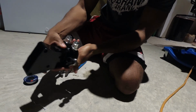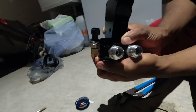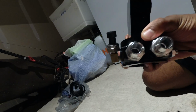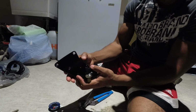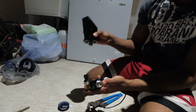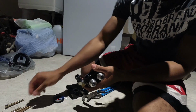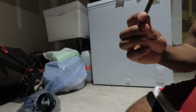Yeah. Just make sure to test fitment. Everything is going. I mean, obviously you're not going to be able to get it any closer because it's right up against the sandwich plate. You know you've got it right. You have like maybe a millimeter of space. Maybe a millimeter. But you have plenty here. The way we designed the oil filter housing is made it nice and thin. So that's why we actually include with the kit these replacement bolts. These are also 10 millimeter, so that's great.